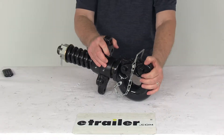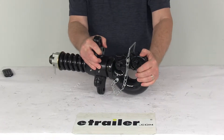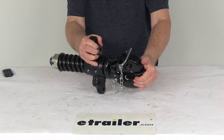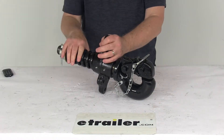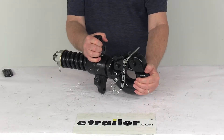Today we're going to take a look at the 25-ton swivel-type pintle hook. This swivel-type pintle hook has both a spring cushion and the swivel action to reduce stress on towing mechanisms and to allow for off-road and uneven terrain towing. The spring will reduce stress upon acceleration, and the swivel action allows for travel over rough terrain.